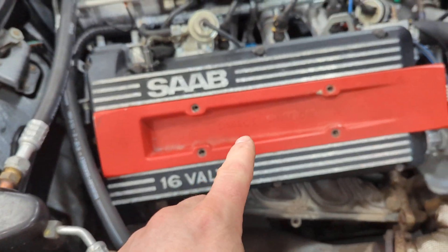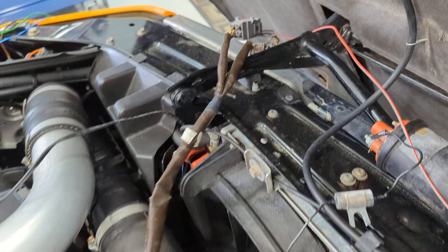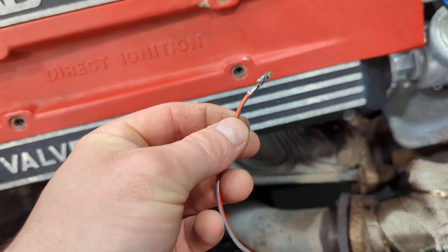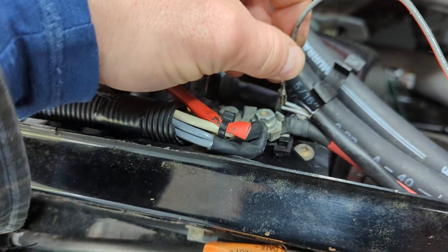As you can see, I've got the resistor spark plugs from the 9000 fitted, the DI cassette installed, and my harness is attached and grounded. You can see it goes to this hodgepodge of wiring right here. The power lead to the actual cassette is right here and I'm going to attach that now — no harm in doing so — touching that onto positive.